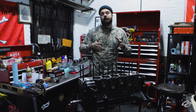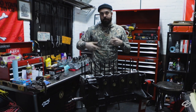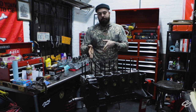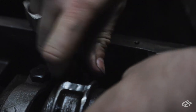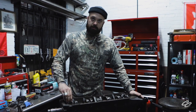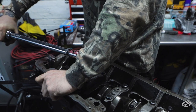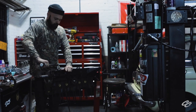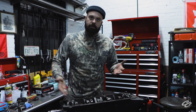Now that our head studs are in, we're just about ready to put the head back on this motor. But before we do that, we've got to flip this over again — because if you remember from our last video, when we put the conrod bolts on, we didn't torque them down yet. We have to get in there now and get a proper torque spec down on the conrod bolts. As far as these conrod bolts go, ARP specifies that they'd be torqued down to 40 foot-pounds. But not once — you're going to go in and torque these three times to 40 pounds. That way you're getting the proper thread stretch to happen in the bolt. You're only going to be able to do this one time, and you need to get the thread stretch situated before this thing starts running through heat cycles and potentially loosening up.